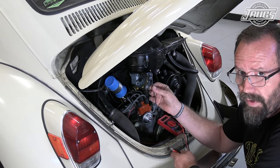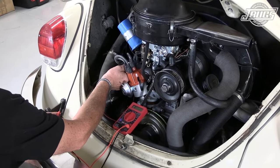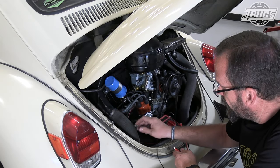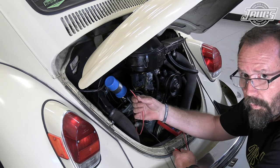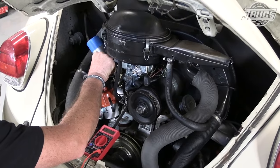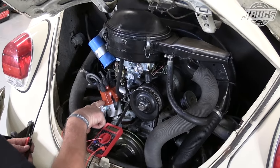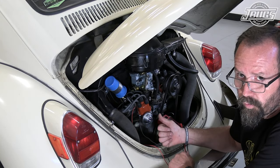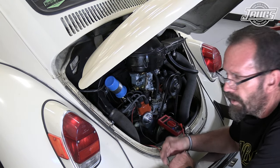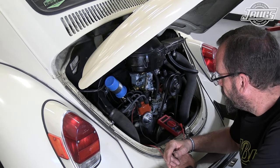A lot of people see this black wire and this black wire and take this wire and plug it in here to the positive side. What you've done, as soon as you hook up the red wire to the opposite side, which wouldn't have any other wire there, if you hooked it up and tried to start it, you've just fried your electronic ignition. So green and brown are 2 common ground colors from Volkswagen. Black and red are both hot wires from Volkswagen.